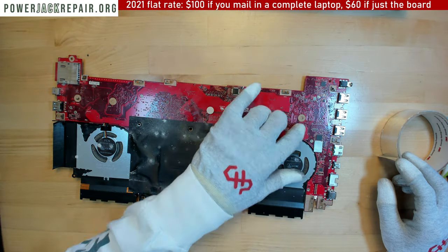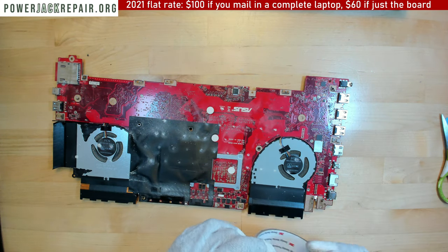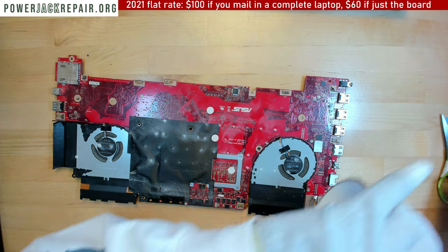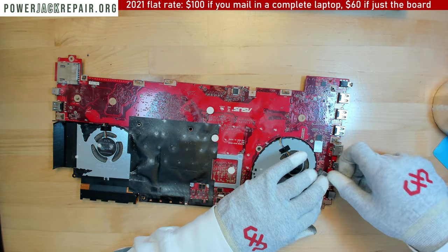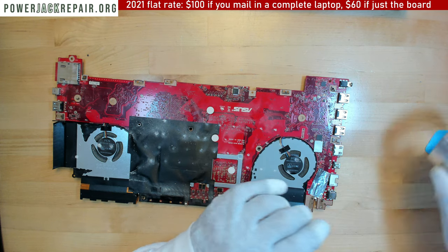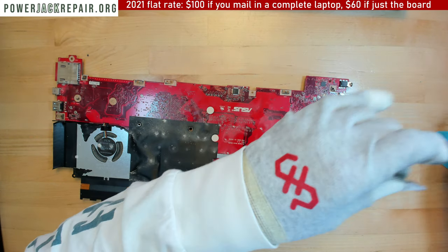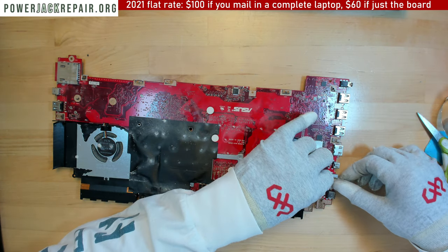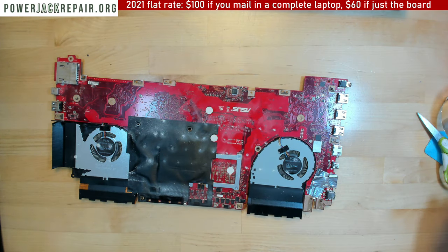Yeah, so the plus goes here and it goes right to this side of the board. We got a whole bunch of dust in there. You know what, that's a much better design. In fact, this is a really good design here. I like it, because sometimes they put a whole bunch of components next to the jack, which can fry for no reason whatsoever. So that's definitely... Let's replace this jack. And it's probably going to be working just fine.